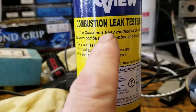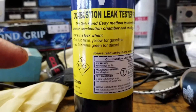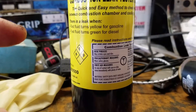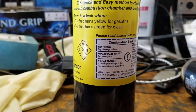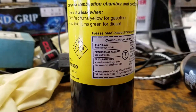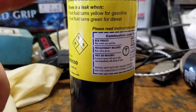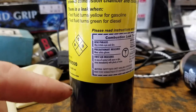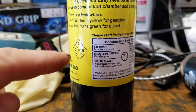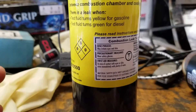What this tests for — what you use it for — is detecting CO2 gases that are inside the cooling system. Coolant does not contain CO2, so we're okay with just regular coolant. If you suspect you have a cracked cylinder head, a cracked block, or a bad head gasket, this is one tool you can use to help verify that you actually have a problem.